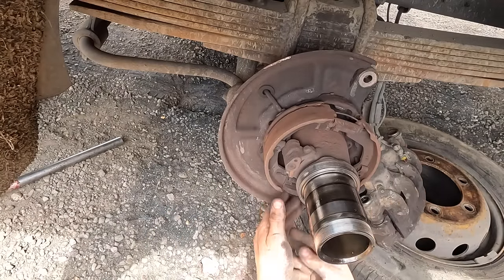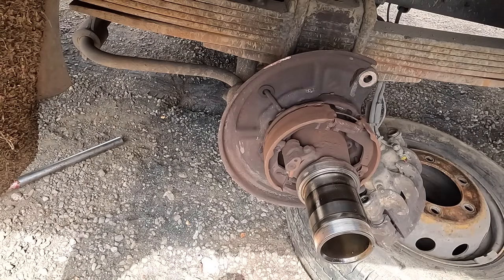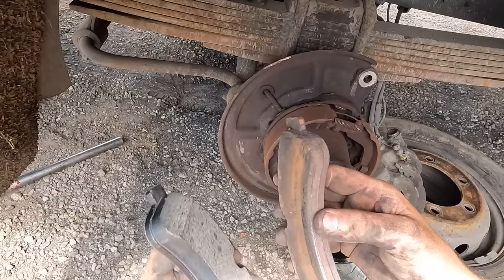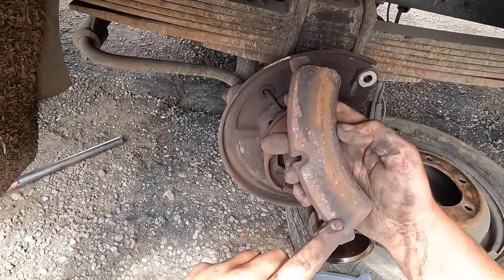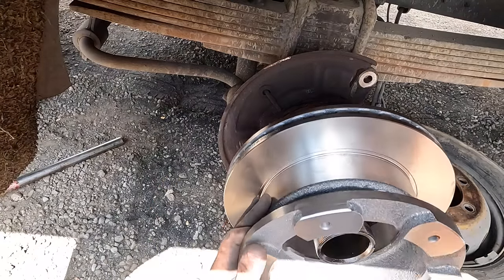There's a bit left on these shoes, so I'm going to lay them. With it being an auto, I'll not need handbrakes much, am I? Yeah, that's short camera. But same fitting, aren't they? Them's as new ones. And they're not that bad, there's still plenty of material left on them. It's because of that lip and its sensor. Well, there it's done. It's worn it away. So I'll just put a new disc on.